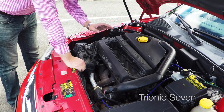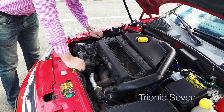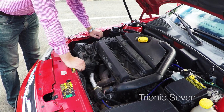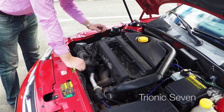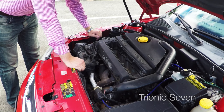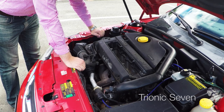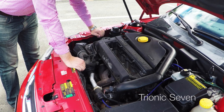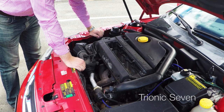What's important with the cassette is that you store it upright. I like to put it next to the wheels while I'm working outside. If you happen to flip the cassette or even turn it upside down, then when you put it back you should wait 30 minutes or up to an hour to let all the oil drain down to help cool the cassette. Otherwise, if you start the car without the oil having come all the way back, you might damage the cassette — and that's an expensive mistake to make.